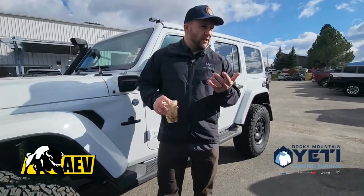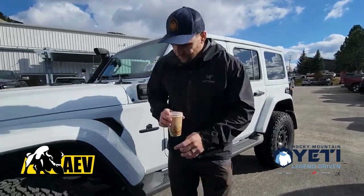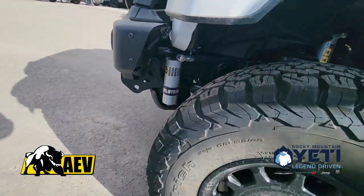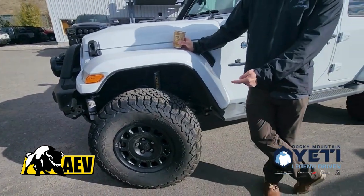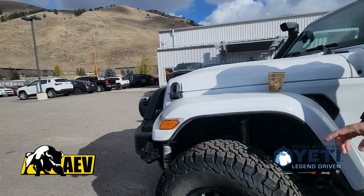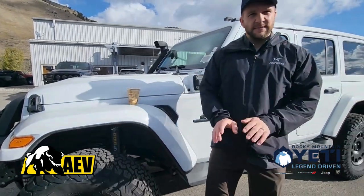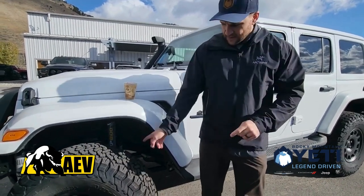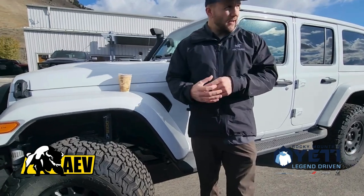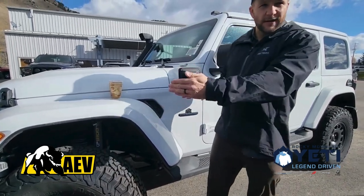In a warranty scenario, if your customer calls and says they need a shock, we'll ask for the VIN number — it's that specific. We make two different shock options: a Bilstein 5100 series and this upgraded Bilstein 8100 series. The 5100 is a monotube shock without a reservoir. The tune in the shock is specific to the engine and wheelbase of each vehicle. Inside the shock are what look like washers or 50-cent pieces — how many are in the body and how thick each one is changes how fluid passes through, and that's essentially how you tune a shock.